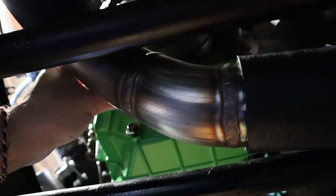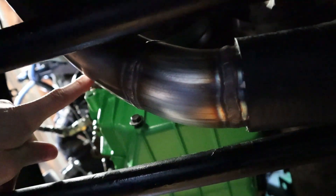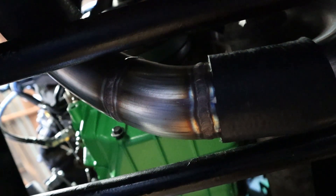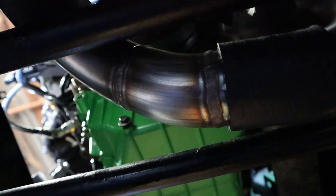Also, about here I may end up drilling out and putting another tube that comes off here to go to our overflow tank for our radiator - that's how the original was, with a tube that came off here and went up to that overflow. I'll probably try to keep it the same. Also, on an LMM Duramax, I can't find any information on where the heater core fluid goes after it goes through the heater core. Let me get on top of the engine and I'll show you what I'm talking about.